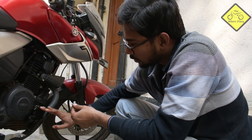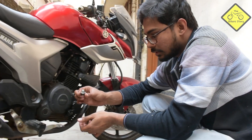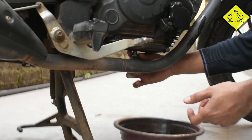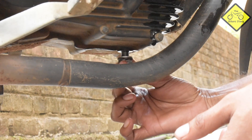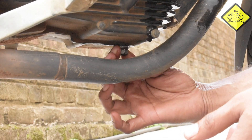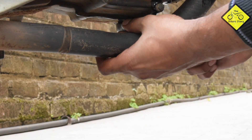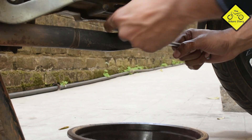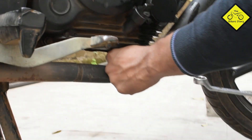The oil filter cap is now tightly sealed. Now I have to lock the drain nut. I have cleaned it. To put the drain nut back in place, I suggest you first finger-tighten it — this way there is less chance of damaging the thread. Initially tighten it to the point where you can no longer turn it by hand. Then take the 17mm spanner and start tightening it. Do not over-tighten it because that won't help and it might damage the thread, which is a more severe problem.